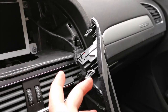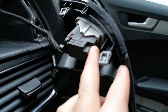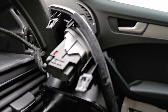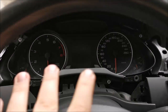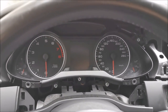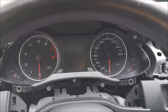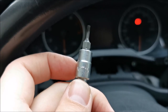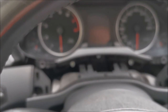I can see the second clip in there and I just need to get this hazard light out. I think it has some metal clips on the side — one on this side and one on the other side. I will not get it out until I do all that I need to do with the cluster itself. If something fails there, there is no point getting that button out, so that will be the last thing. Let's undo the three screws underneath and I think two on top — let's get this cluster out. To undo these screws you need T10 Torx.